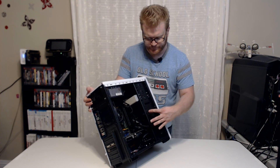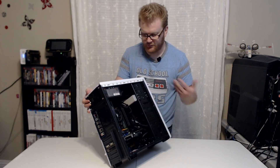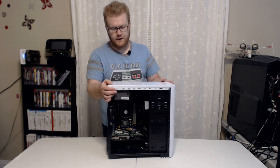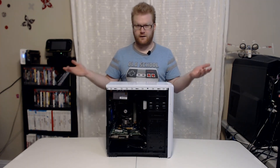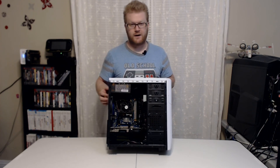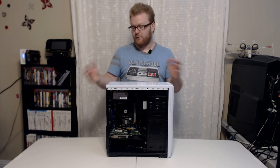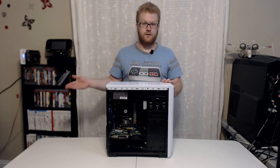But honestly, it's not too bad. Most people do one solid state drive and then one regular hard drive — like a 500 gig solid state and a 1 terabyte. This is just a budget system case anyway. So final thoughts: it's a little bit of a pain to work in. I chose one of the worst layouts that I have in my collection of computers, so it was pretty much worst case scenario. You can't put a radiator in this unless you're doing an H80 in the rear, which is kind of a bummer. But if you really wanted to, since it's such a cheap case, you could mod it and probably fit a radiator up top. For $28 or whatever it is, it's not bad. I'm going to leave a link in the description below to find this case.